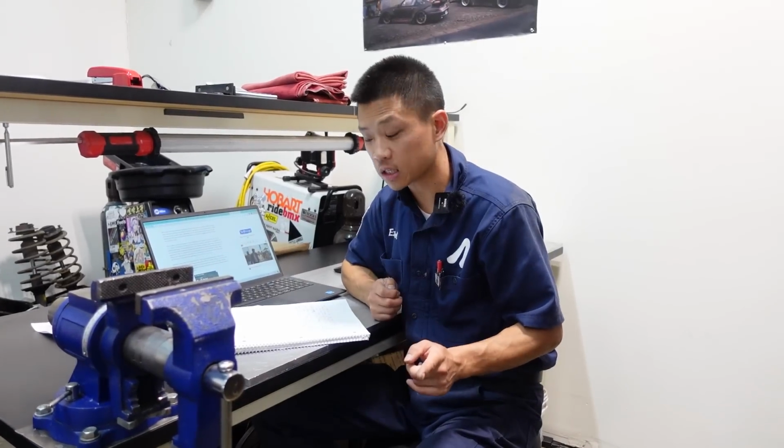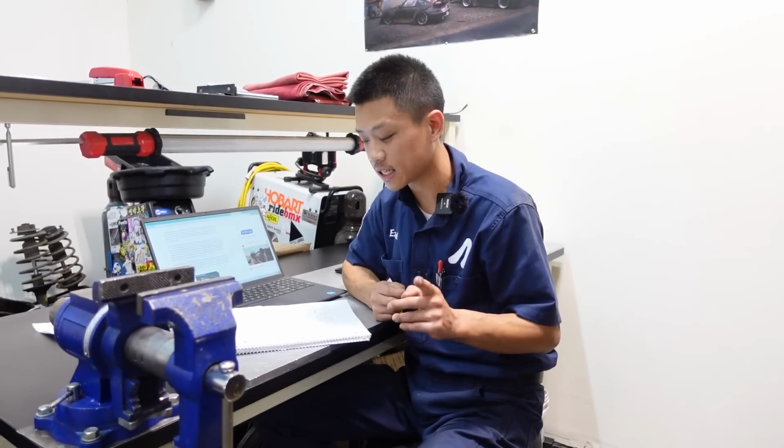What did I see over time? So doing all these warranty repairs, cam cover reseals, which is an engine out job, by the way, totally sucks. Doing a whole bunch of timing cover reseals on both the H6 and FB engines, and later on FAs. At a certain point, I saw the engine started to get sealed with a dark gray, a different color silicone. I forget what the original color was, and they used a lot of it, and the engine still leaked.